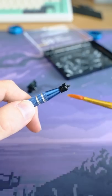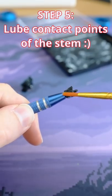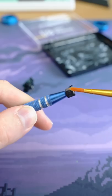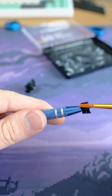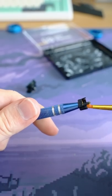The goal here is to coat the spring with a light layer. Why do we do this? So it doesn't ping. Next, you want a light layer on every contact point of your stem — these are all the points that are going to be making contact with the inside of the switch. You can also lube the inside of your switch, but it's kind of redundant.